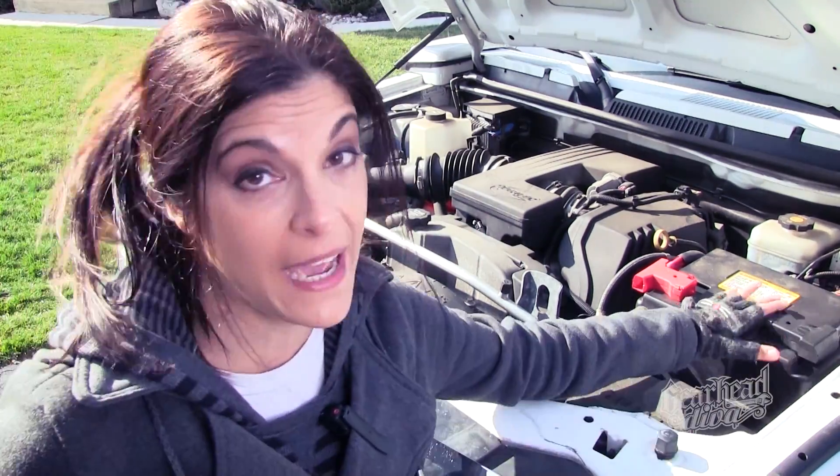My recommendation is always to start with your battery like we did in part one. Going through those tests we found out this battery was just not up to par, so I went ahead and put in a new one. My battery had been five years old, and in battery lifetime that's ancient — batteries only last about three years before you start having problems. Although it could hold a charge, when it came to the load test it performed at its very minimum, and I don't want my car failing me at the worst possible moment.